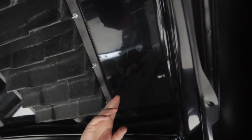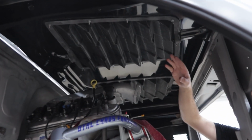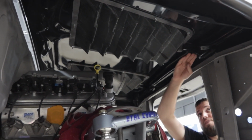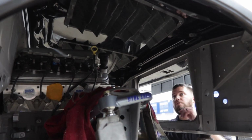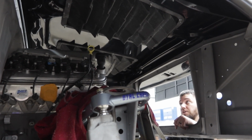Another neat thing about these hoods is this is actually a two-piece, so you have your full exterior structure of the hood, and then this is a fully enclosed, finished interior underhood structure. So it's finished out really nice. You don't see the raw carbon or raw fiberglass weave, like some hoods, which is basically the bottom side of the top layer. This one's fully finished out, so you can paint this thing body color inside and out, and it will basically be perfect when you're done.